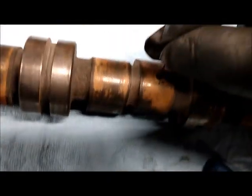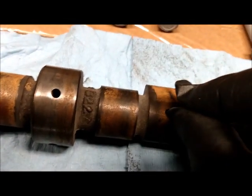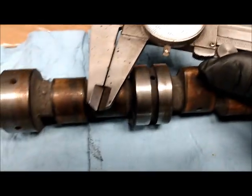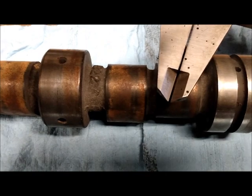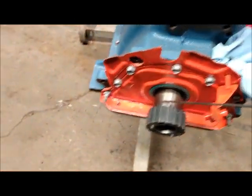Inside here there is a secondary hole on all of these cam lobes, just to have a small amount of oil feed pouring onto the lobe. It is actually a thirty-seven thousandths of an inch hole. So you can imagine a little piece of silicone coming in and jamming up from inside that gallery, trying to force its way out through the hole onto the cam lobe.